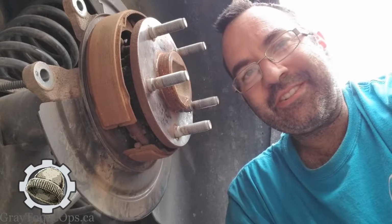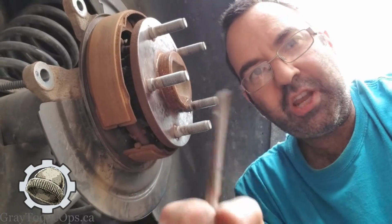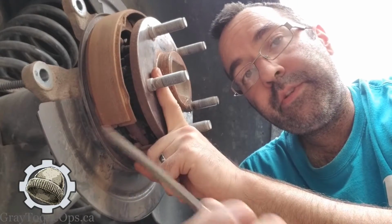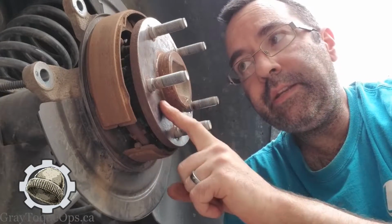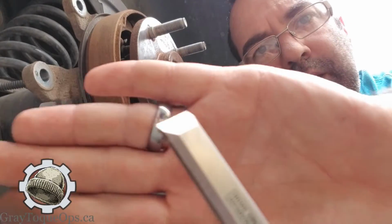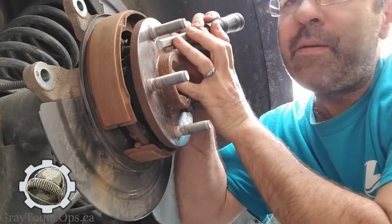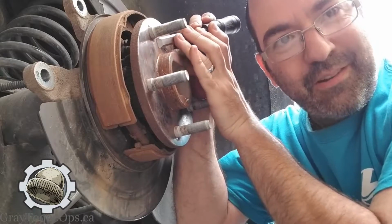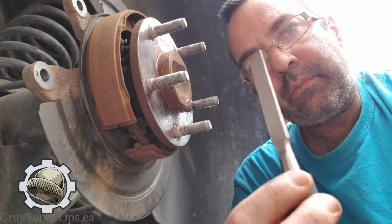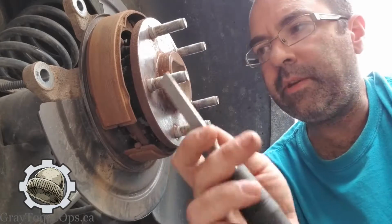The pulsation is just terrible. You're coming off the highway, you're hitting the brakes, and the thing is just shaking like crazy, right? And that's pretty much from that. There could be other reasons why it does it, but guaranteed it's because someone didn't take the time, like a guy like this, meticulously scraping. Oh my god, this is gonna take me forever. But unless you're meticulous about it and get this surface totally clean, and I'm not saying you got to eat off of it, but I mean, you got to go around with your finger.